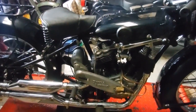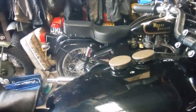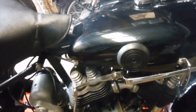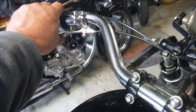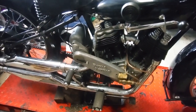Here's that Royal Enfield Model K running again. This is just going to be a short video. They have made up a replacement for whatever was missing holding a decompressor cable on, and I've got a cable made up and working. To demonstrate, the decompressor only seems to operate the one cylinder, which would kind of make sense, because if you knock the compression of one cylinder away, you've only got to overcome the other one for starting. When I decompressed it there, it just kept going on one cylinder, so the other one was knocked out, and one remains with full compression for running and starting, I guess.